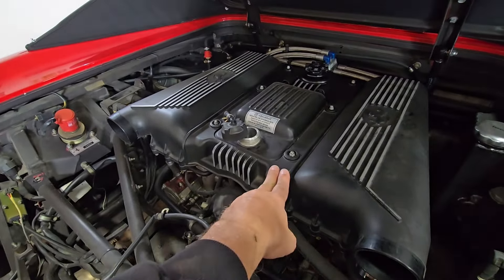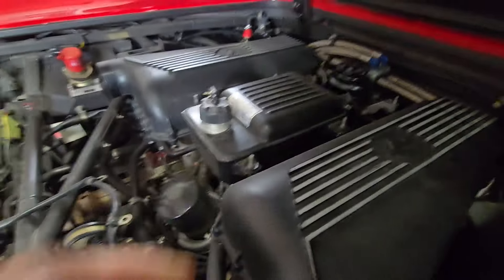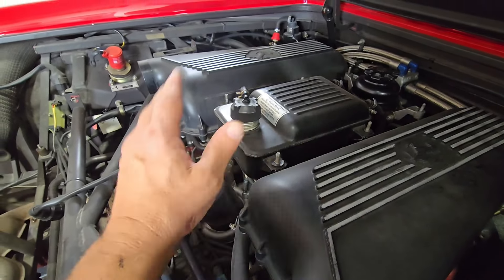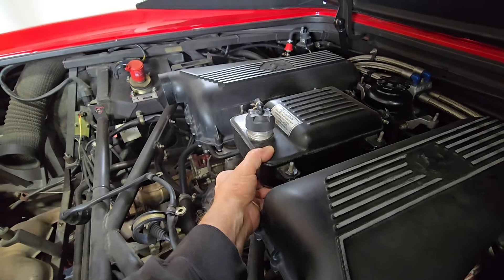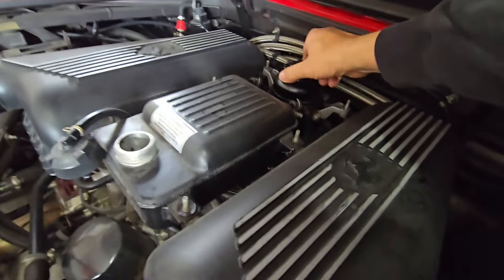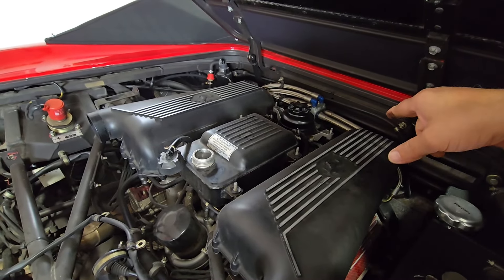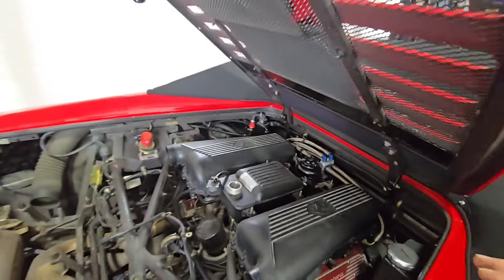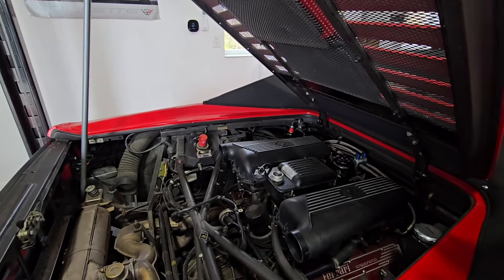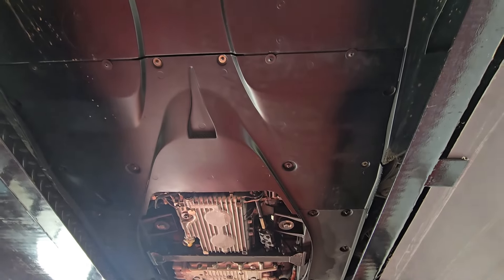Before we go to the exhaust, we're going to remove this cover here — there are tens along there, should be six of them. We've removed that cover. There's a nut, a washer, and a spacer that fits on all of these, so be careful when lifting it up that you don't drop them. So now this coolant tank is loose, and the power steering reservoir should be loose too. We'll have to get to that at one point because there are water lines in the back that need to be disconnected eventually. We may take this cover off here just to make it easier — sometimes on the 348 we've left it on, but it may be easier to take the engine cover off.